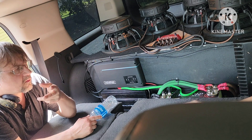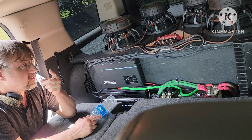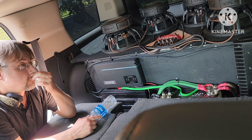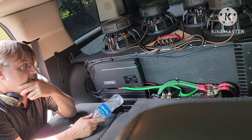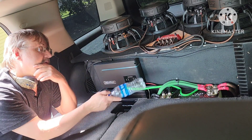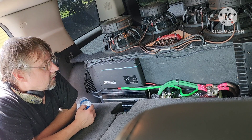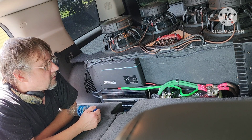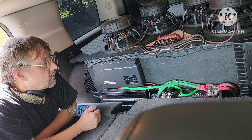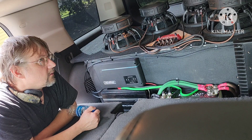Whenever you're dealing with drum beats and bass notes, even a half second is a long time. Jerry mentions he has two alternators — same problem. Two alternators, one battery, or even two alternators and three batteries, still has limits. The question is whether adding another big truck battery or another supercapacitor would help. The current system is pretty stable — it's right on the edge of being perfect. Having more storage for the capacitor to draw from is always good, but you can have more than you need.